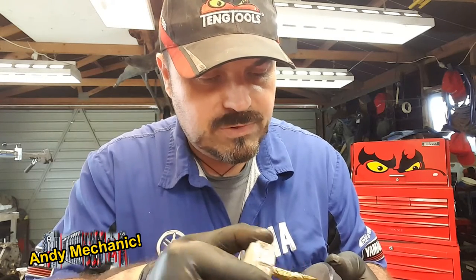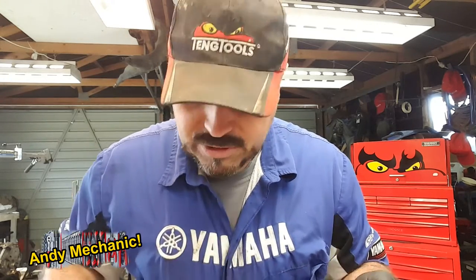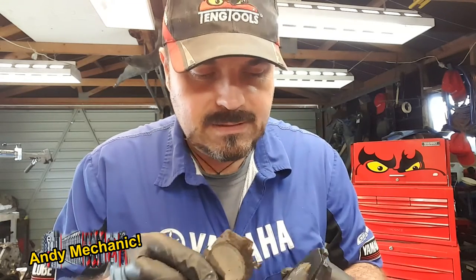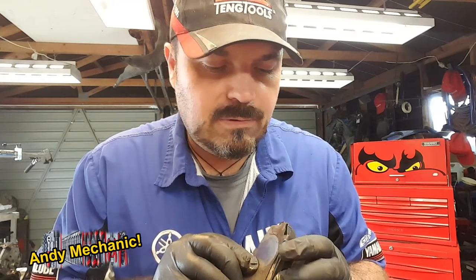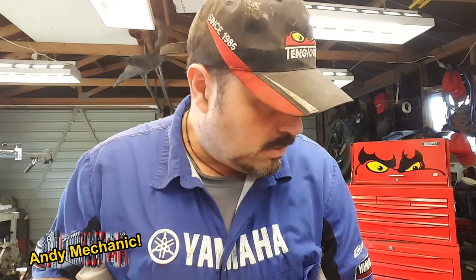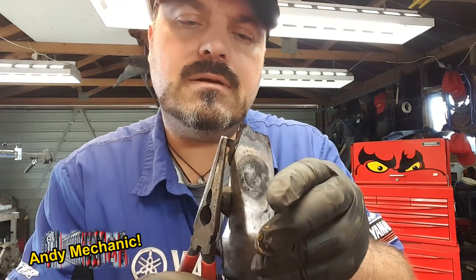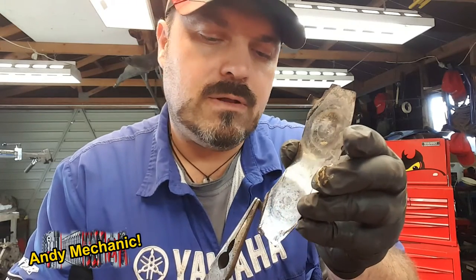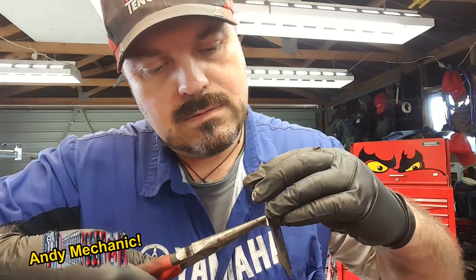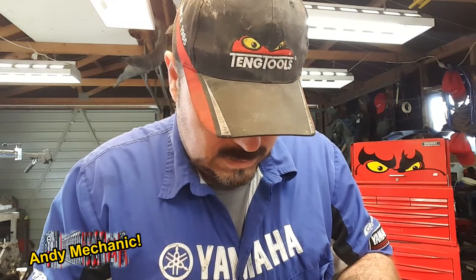The last thing you want is to risk this kind of stuff getting on your friction material. But it helps to glue this to the pad, and that prevents things like rattles happening. Now what I'll also do is just bend those little clips, because they're a bit weak, they're not really clamping onto the pad that well. Just be careful not to snap them off. You don't want to do that. But we need that just to stay in place, really, whilst we're assembling it, to be honest. Okay.